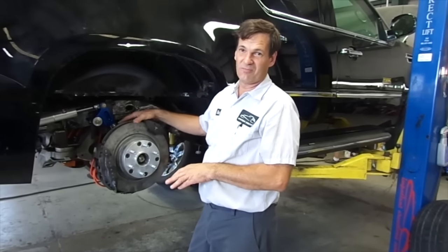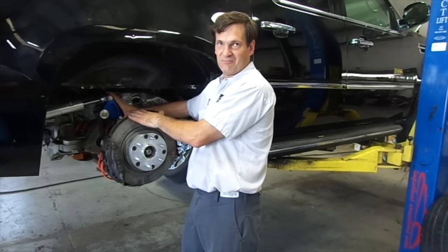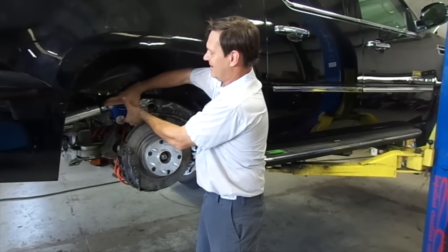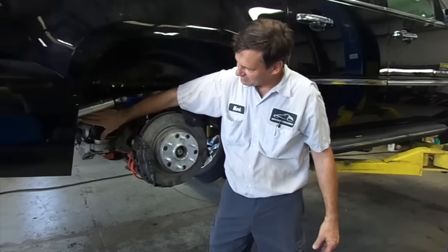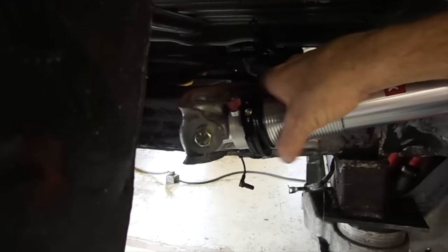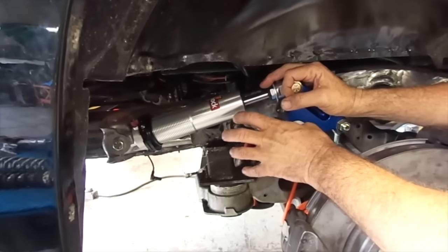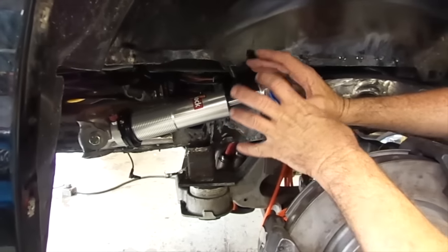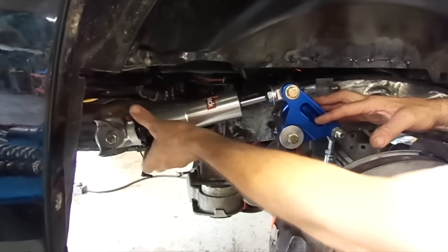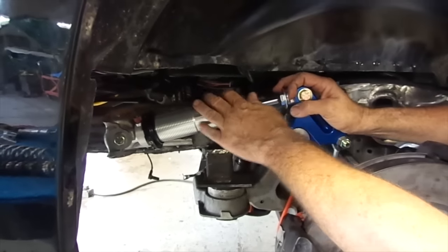So we're allowing basically for two inches of bump and one and a half inches of droop. In the industry standard for most street cars, that's more than adequate. For a pickup truck you'd generally want more, but this is Jack's personal driving vehicle and he's not going to be hauling boats and trailers. So this will work. The other shock mount here — instead of being vertical, we've laid it over to the side and welded it along the frame. The coil spring goes over the body and holds the weight of the vehicle. With the coil spring we can change the weights to tune the truck and hold the ride height. The ride height is adjustable by the screw mechanism, which pushes on the spring. How stiff the suspension is is controlled by the spring rate.